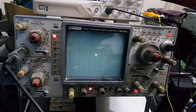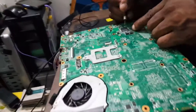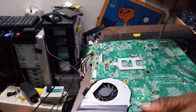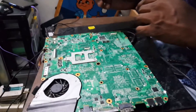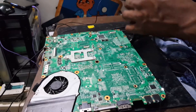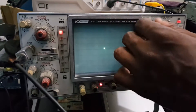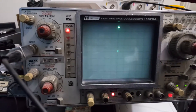We are going to check the chip select signal — this is chip select, pin number 1. So when the adapter is inserted and AC-in signal is present, supply reset and clock, then the IO controller will start to read the BIOS. And pin number 1 of the BIOS chip is the chip select. We are going to use the analog oscilloscope to see a good reading, and we are going to put the probe on pin number 1.